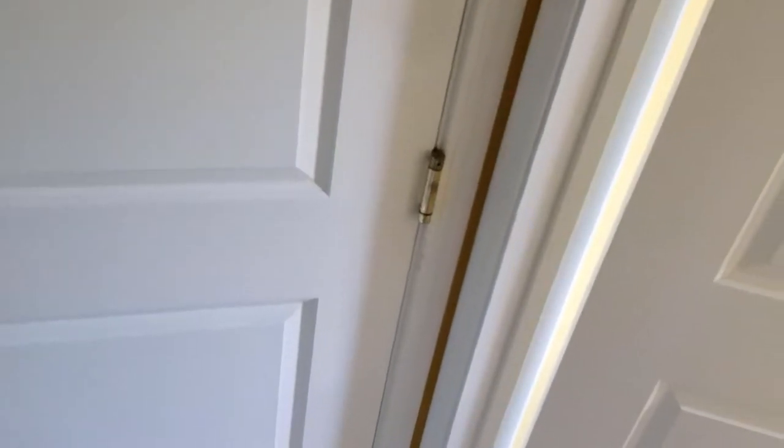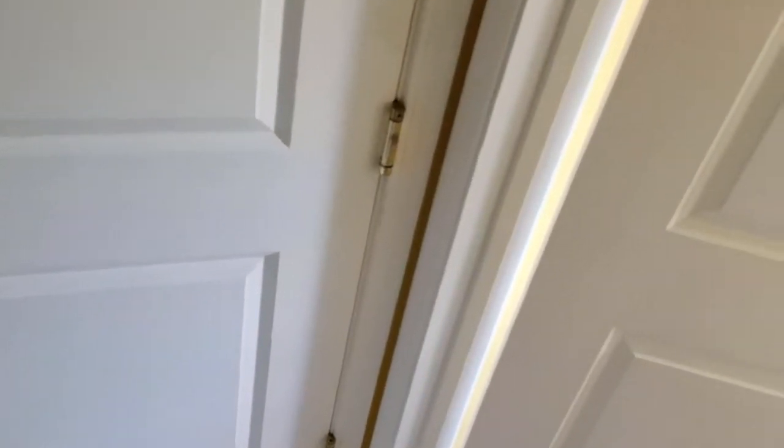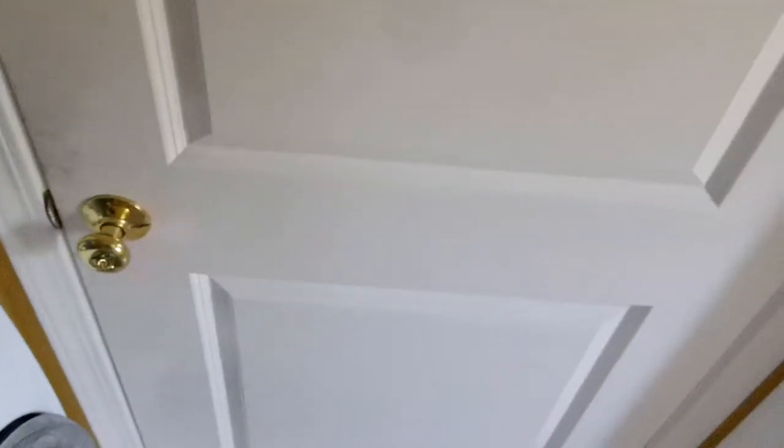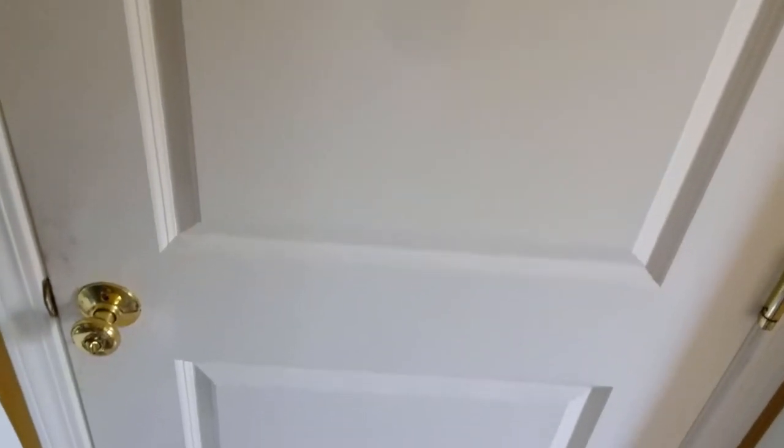My apologies for not being able to see the first coat, but you saw the second one. The first one is pretty boring - it's just a tack coat. You saw I made a mistake - don't freak out. Take a piece of paper towel, don't press hard, and just let it under its own weight kind of wipe that edge, and the clear will just grab onto it. We'll give it 15 minutes then do the last heavy coat. We're done with the edges, so that should give us enough paint left. The panel is straight up and down, so we should be able to get all the paint out of the gun - and obviously it's a gravity feed gun. Stay tuned, 15 minutes and we'll be right back for the final coat.